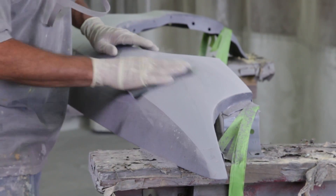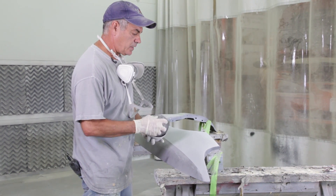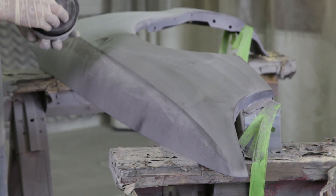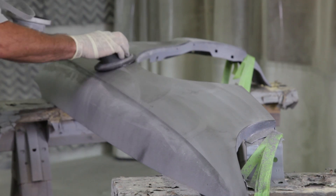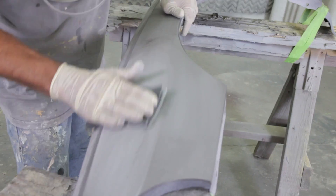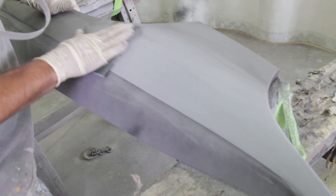Guide coat will let me see all my 320 scratches — I'm smearing the guide coat into the 320 scratch right now, because with 320, especially with metallics, you will definitely see that in your paint job. Typically you'll want to go 600, and on silvers maybe 800 or even 1000. For metallics I recommend at least 600 to 800 depending on the color. If you get too fine you really don't get a good bite with your paint either — I wouldn't go over 1000 on anything.